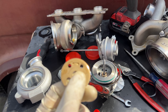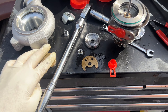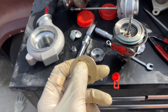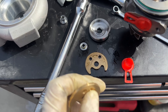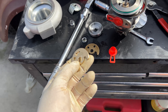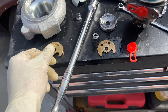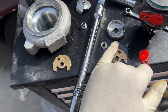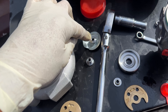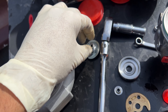So the V4 turbo is out. Here's the thrust bearing — it does have an extra oil port. But this one is from Turbo Lab America and as you can see, that one is way bigger and then tapers to small, while this one is just small throughout. I'm not sure how much that would affect it, but at least it has that port. One thing I noticed is that this oil port is smaller than the one that comes in the Turbo Lab America kit.